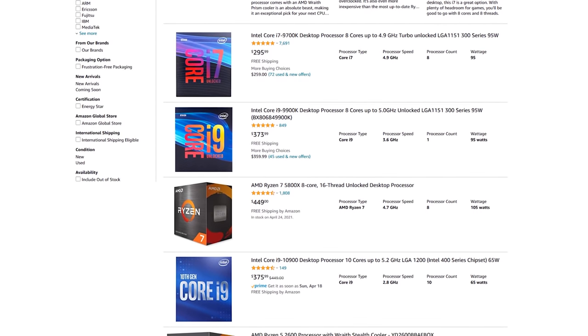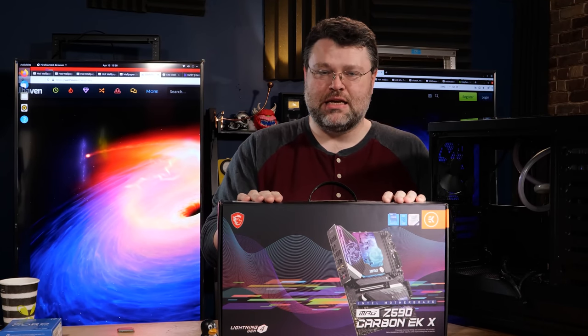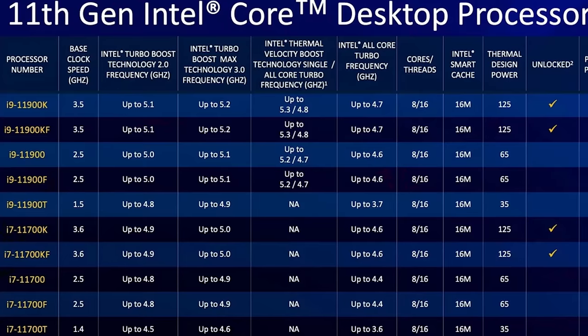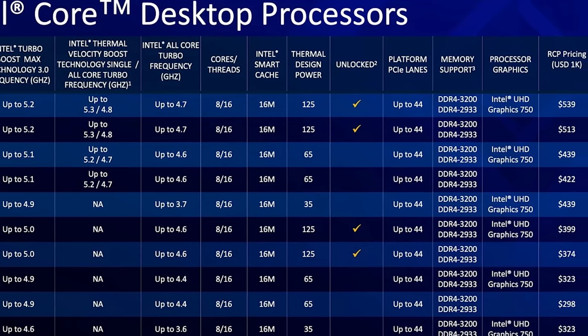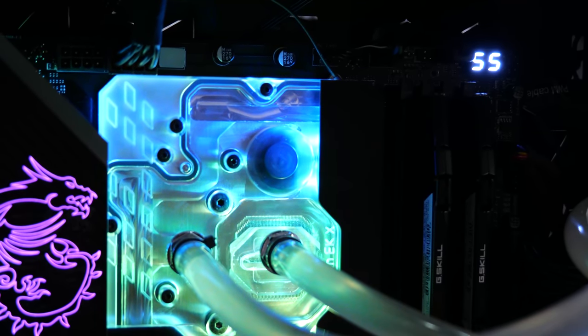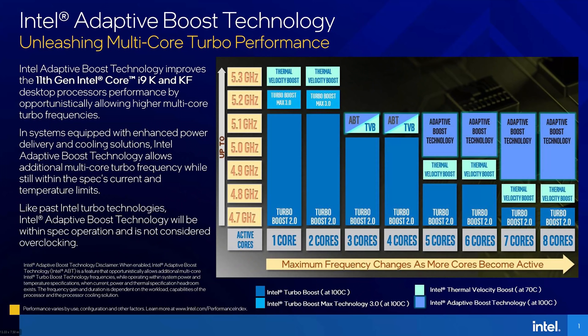It's hard to find things at MSRP right now, at least at the time I'm making this video. I'm going to put an i9 in this because I'm going to splurge, but my recommendation is to go for the i7. The price difference from the i7 to the i9 — you can get all the performance out of the i7 that you were going to get out of the i9 anyway. With the custom loop cooling on this motherboard, that's why you'd pick it. The one possible exception is adaptive boost, which is a little better on the i9. But you can just do the 5 GHz all-core overclock on the i7 — that's all you're going to get anyway.